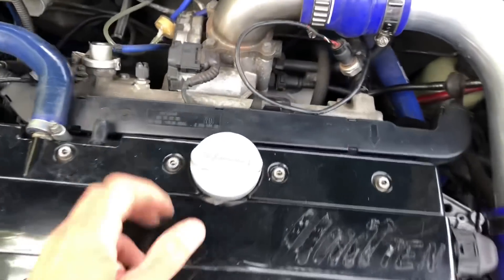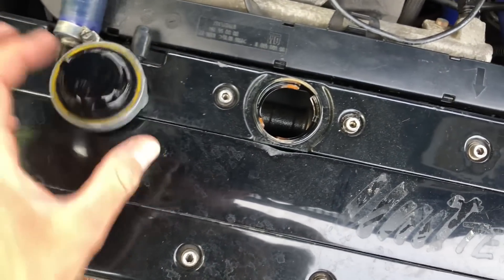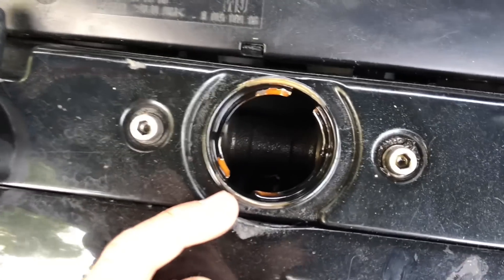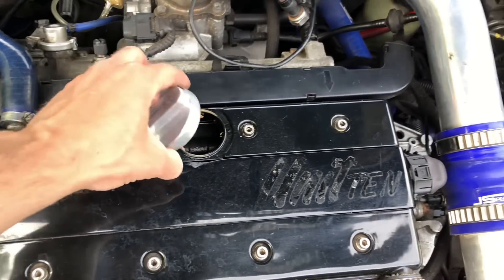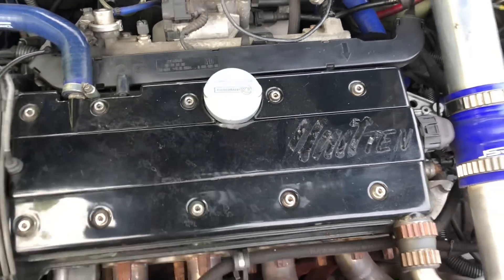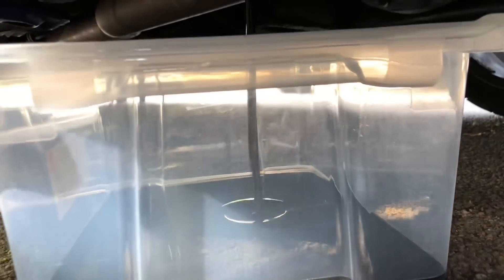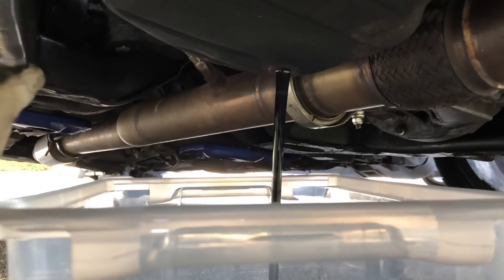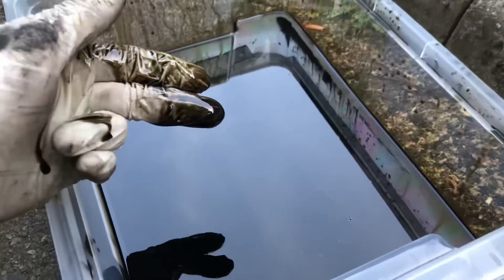One of the things we've got to sort out right now: because the cold start is so bad, the fuel is getting into the oil and contaminating it — you can smell it. So we're going to drain the oil out. We need to check what plugs are in this because they look very old. We'll pull them and drop the oil to show you the state of it. Using a nice clear container so you can see the oil — you can see how black it is and it absolutely stinks of fuel. Fresh oil filter in — GM1, now PSA — and fresh oil in; it should be good to go.